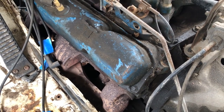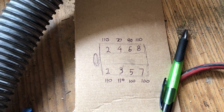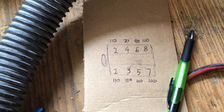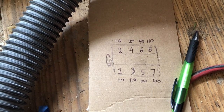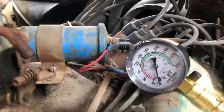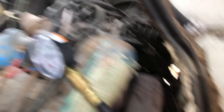They say that 100 pounds of compression is a minimum per cylinder, and that you want to be within 10 percent range of each cylinder. So this is my diagram of what I came up with as far as pressure. You can see cylinders four and six are down at 70 and 90 respectively. I'm going to put the pressure tester back on there real quick, crank it over, show you how slowly it's cranking, and then re-verify that it is the same pressures. Okay, wide open throttle cranking - 90. That was cylinder number six. I was getting 90 before, getting 90 now. Moving over to cylinder number four, which was getting 70, to re-verify.